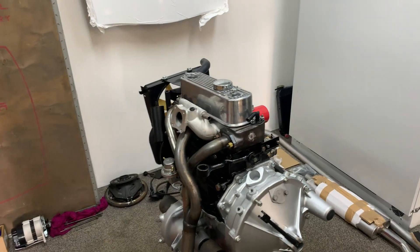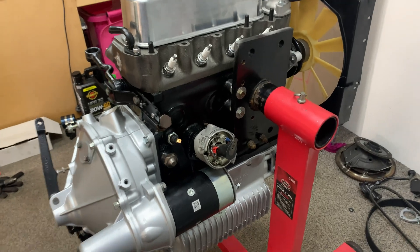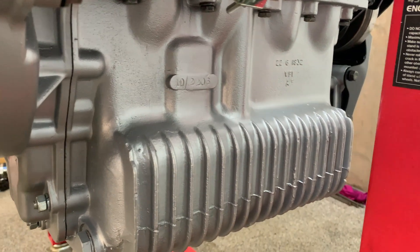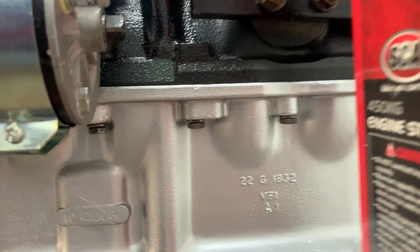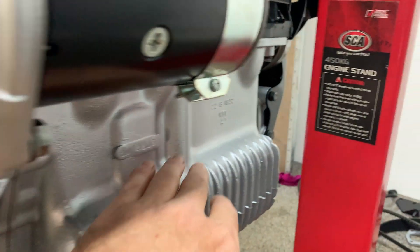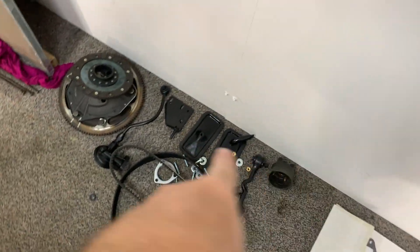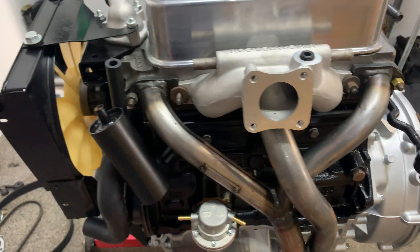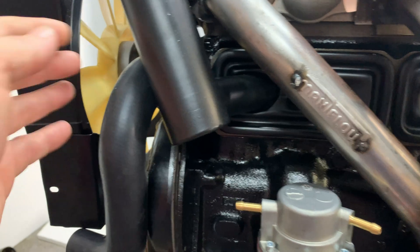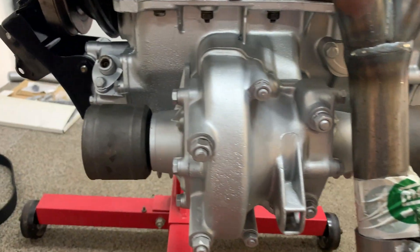Time completely got away from me. I did such small amounts of work to this motor over about a two and a half week period, and this is where I'm at now. It's pretty much rough together — I've got the gearbox on. I reckon it came up all right actually — did about four thin coats of paint on that. I haven't got the new screws for here, but I did try and clean them up as much as possible. I also have to go through again and clean it, because I'm starting to see another couple of little grains of sand in some of the orifices I didn't block off well enough. It's looking pretty good. The clutch isn't in there at the moment. We've got the new fan belt, a few other little accessory bits still to go on it, plus the rest of the stuff painted up here — the breather, hoses and pipes. Trying to lay it all out so I can visualise how it all goes together and whether I'm missing anything.